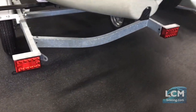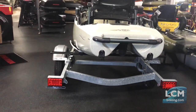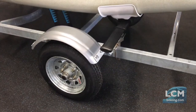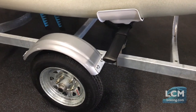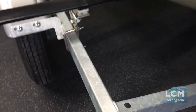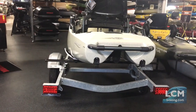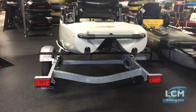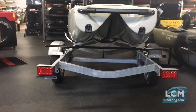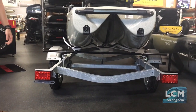You technically don't need to unplug your lights like you do with old-school powerboat trailers. This Trailblazer trailer uses a torsion axle, so it's independent suspension per side — there are no leaf springs underneath. The ride is extremely smooth and very quiet. You can see how that boat fits on the trailer; this is just doing one ProAngler 17T, but we can do up to two on these trailers depending on how we set up the bars.